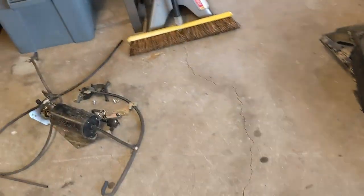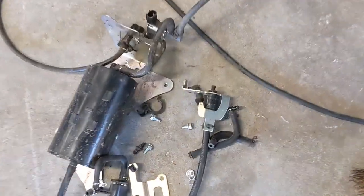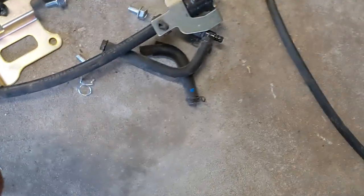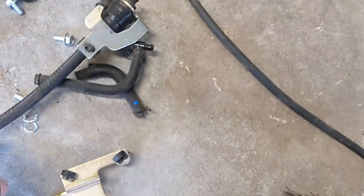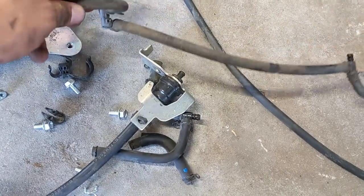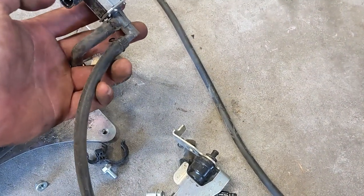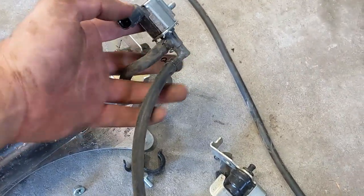While I'm in here fixing Yamaha's problems — which shouldn't be problems in the first place — I decided to delete the charcoal canister air injection setup. I'll show you where it all came from, these big brackets and everything. Most of it was in the same spot. This little bracket came out from under the shifter and was holding this guy, but the rest all came from right next to the oil tank. There's one connector you have to unplug — we're going to see if it throws a code. If it does, we'll simply cap the ports and plug it back in, leaving the solenoid in place but doing nothing.